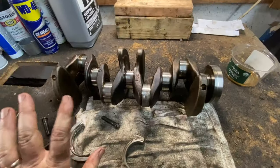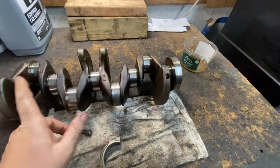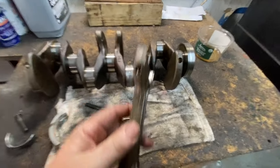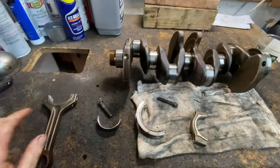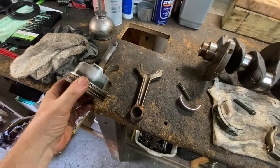Now, if you're going to try to do it yourself, like I just told you, the crankshaft at a minimum, new bearings at a minimum, the rod that blew out, it's usually only one that blows, you get a new rod. And if I was you, when you pull out the rod, check the pistons. If the pistons look good,